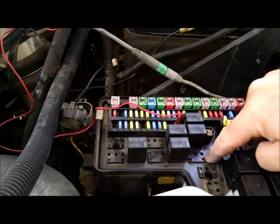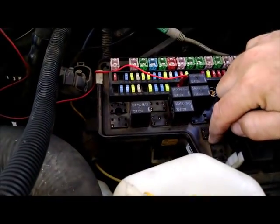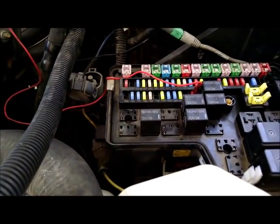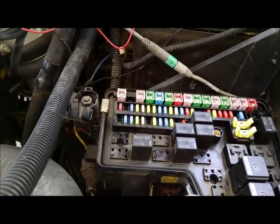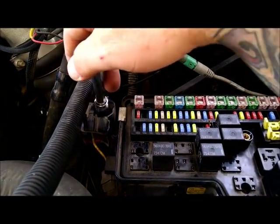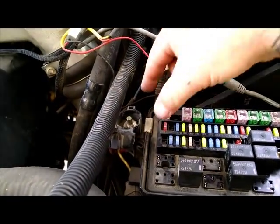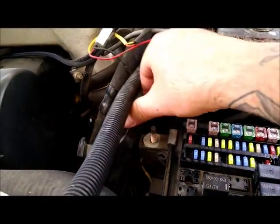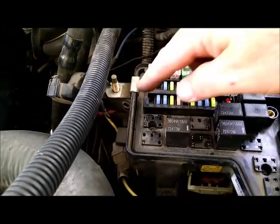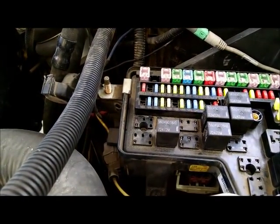This is the fuse box and all of the relays that are, quote, not changeable according to the dealer. The ones we need to get to are underneath this. They say it's not designed to come apart and just needs to be replaced, but I believe we can get into a couple places, remove a little plastic, and get this separated. We're taking a ratchet with a 13mm socket placed down in here to loosen the main power connector for the fuse box. We'll take that nut out, pull it off, and free up this assembly to lift off the stud.